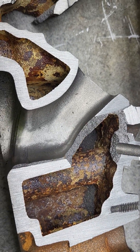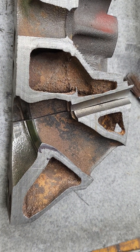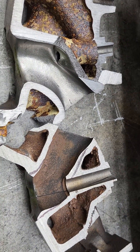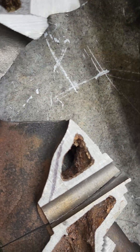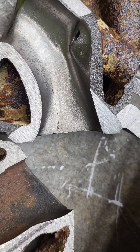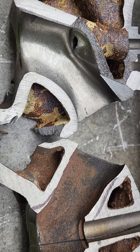Versus the Magnum — the Magnum's been opened up to a bigger valve, I think I went up to a 1.6 on that, but it is a much better design. Looking at the intake port roof, the 318 port is not really great, while the Magnum opens up at the very end. I probably wouldn't have done it that way, but you can see the short side is night and day between the two designs.